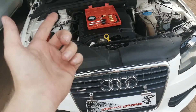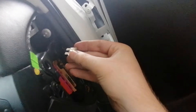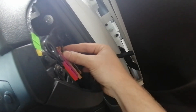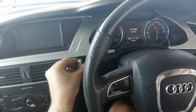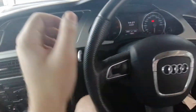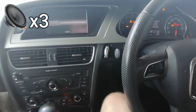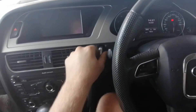I'm truly happy with the outcome. Let's put everything back in and reinstall the fuse — back into slot number three. Now we'll take the key, insert it, and without starting it, press it in once to listen for the fuel pump prime. Let me close the door to reduce squeaking. Are you guys hearing the fuel pump? We'll cycle the key again to build up fuel pressure.